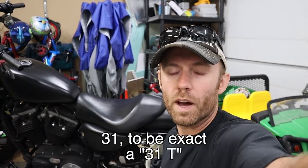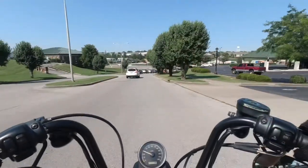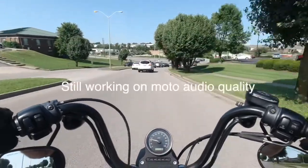I'm going to increase the final drive to lower the RPMs at the top of the rev range. In today's video we're going to put that on. I'll do it before and after with the stock sprocket versus the new sprocket. There's no tachometer on an Iron 883, so we'll just have to ride about 70 miles an hour, see how buzzy the engine is, and see if we've lowered the RPMs. I'll give my overall thoughts on it. Let's take the stock sprocket for a ride.